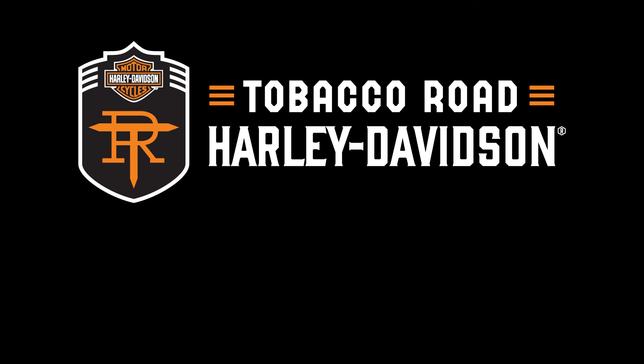Lastly, the S — stands. This is to check the center stand or side stand. The only Harley-Davidson that's going to have a center stand is going to be the Pan America, and some of the police bikes have center stands too. But most bikes are just going to have that side stand. You want to make sure it has smooth operation all the way through, and if you start hearing it squeak when you're going back and forth, then it might be time to lube it up a little bit. Make sure it's not damaged, bent, or broken, and that the spring is on there good. If you're putting the side stand down and it feels weird, chances are something might not be right — that might be a good time to bring it here to the service department and have them check it out for you.